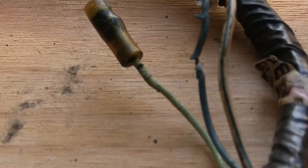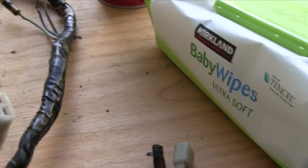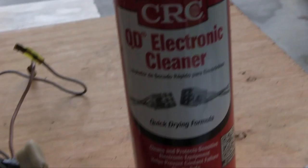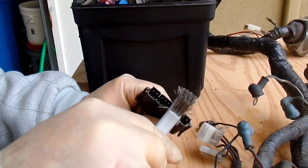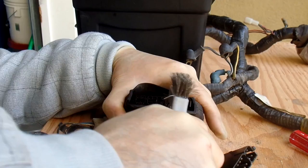Here's a wire that's a little bit frayed — it'll have to be replaced. I'm pretty much just cleaning it up using baby wipes to wipe the exterior of wires and the loom tape that covers everything. I haven't had a baby for 20 years and here I am sitting with a pack of baby wipes. I'm using electrical cleaner to get inside sockets — it's doing a good job. A little wire brush is helpful for scraping the exterior of the plastics, and sometimes I dig in there with long bristles inside a socket. It's going well, just time consuming.